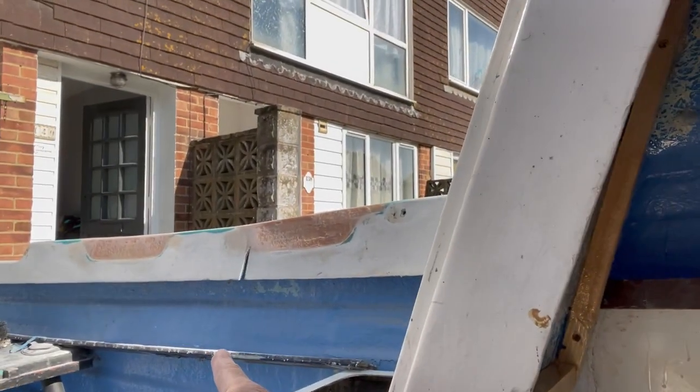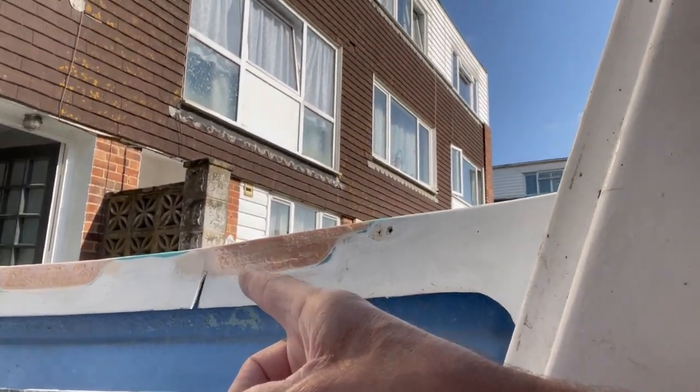It's got to have a 265 watt solar panel on the roof, on a canopy. That's the reason why I've put those bits in there and the other bit. So I'm going to do the same the other side. And I've resined them in, screwed them from underneath with wood, fiberglassed them all in. And hopefully they're not going to be taking any weight. They're going to have little 25 mil sockets, I suppose, plastic or stainless steel, and then have some nice stainless steel or aluminium uprights for a canopy. That's the plan, whether it happens or not.